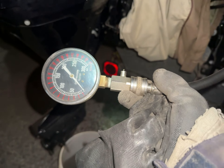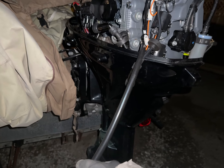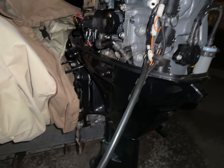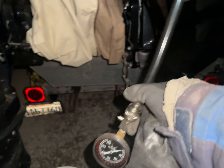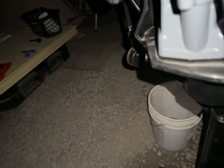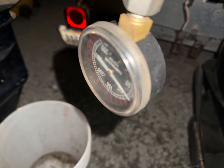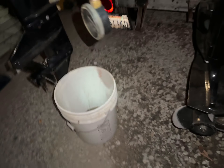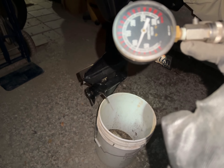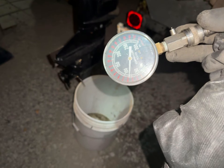This is the last motor on the bottom. We need to get 150 because everybody else got 150, and this is the bottom motor. This is a Suzuki 25 horsepower EFI, around a 2021 year model — probably three years old. It's 10/14/24. Let's see if we can get some PSI. Whoa — I only got 75. That's not good.